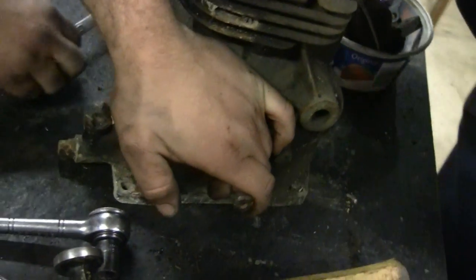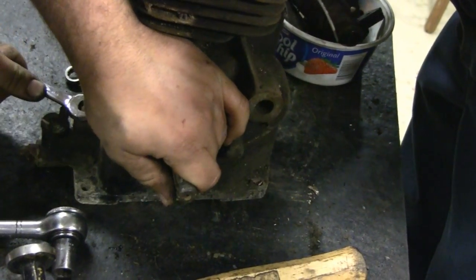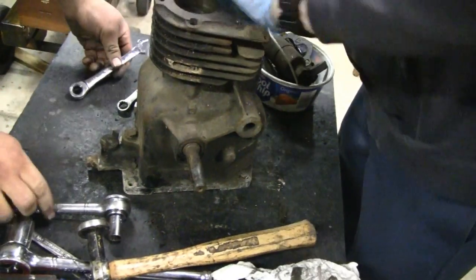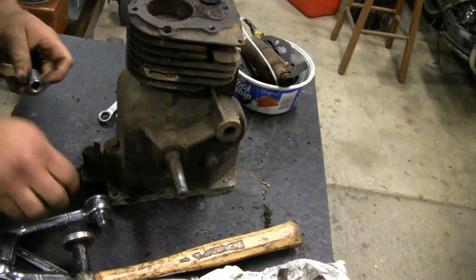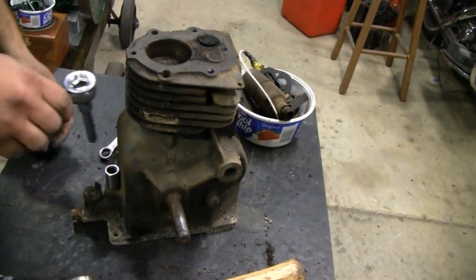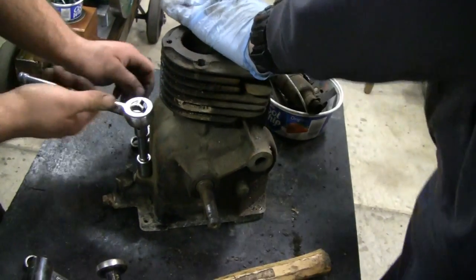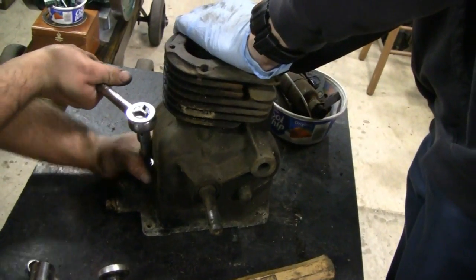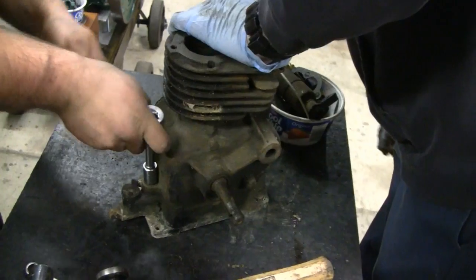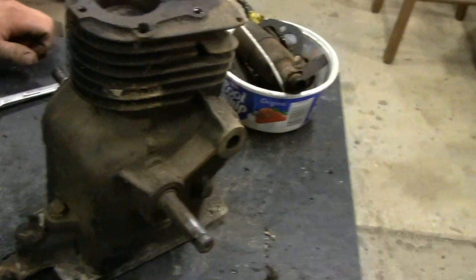Oh, it's the magic hammer. There's not enough clearance to the block, and the surrounding. We need a long extension. There's a couple more in the middle drawer there at the top. It'll work. Michael, just hold that engine there. You rounded it. 12-point socket — not the best way to do it. You need a six-point socket.